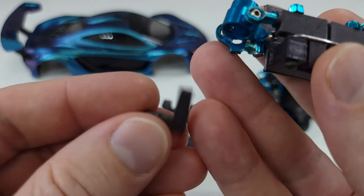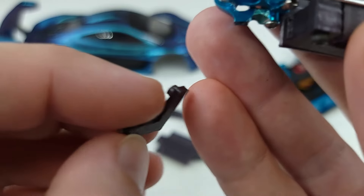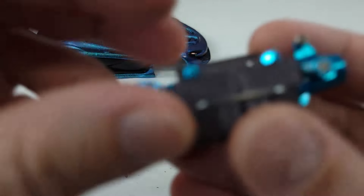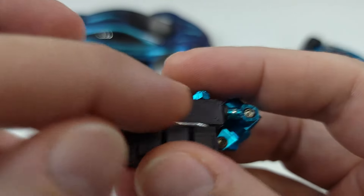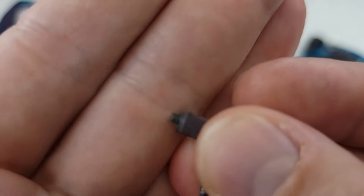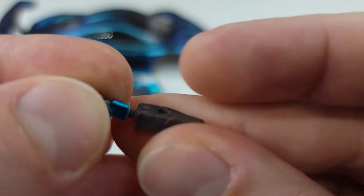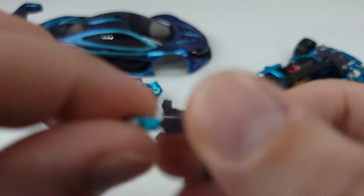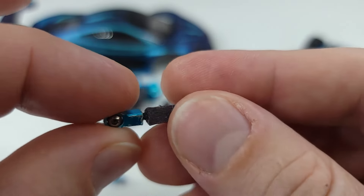And this is the old prototype version of the swing arm. I made it much thicker because it was a little bit too flimsy when I made it this thin — this was just to see if I could make it work. So I thickened up that design, as you can see — it's much fatter here. What you have to do with these upper swing arms is you have to add a screw into them, so you can put on these little pieces here. And then you can unscrew them or tighten them to give you more camber. That's how those work.